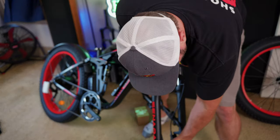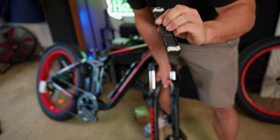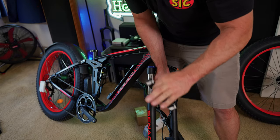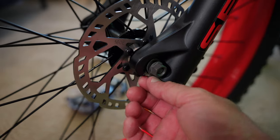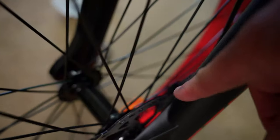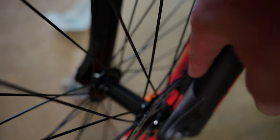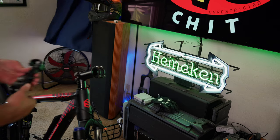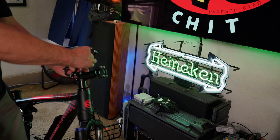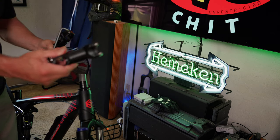It can be a bit awkward at this point. It comes with this nice little fork spacer in there. What this does is it protects the fork from getting bent if it gets hit during shipping. The tab on that washer lines up to the bottom of the dropout, and you have your brake rotor going through your pistons on the brakes. Now we're going to put on our new adjustable stem — Allen bolt out of the top here to remove the stem cap, then take off the old stem.